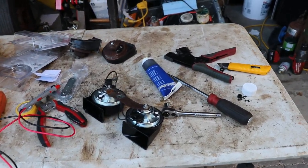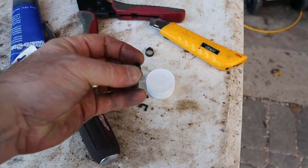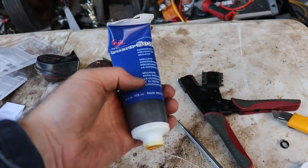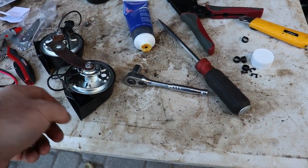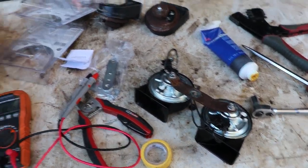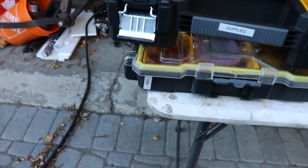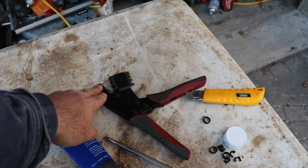There's been a change in direction. What I ended up doing was cutting off the locking tabs and the seals on the connectors, and they plugged right onto these Fiamm horns. I used some wiring harness sealant on the connectors, and I might put a little bit of tape around them as well just to make sure they don't fall off — greased connectors with nothing to hold them can pop off. I've also got quality crimps that are marked with a die to show you've used the right crimp size.